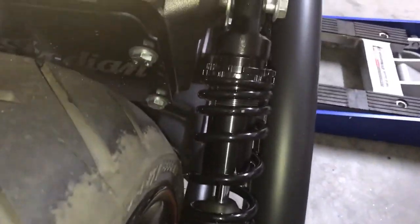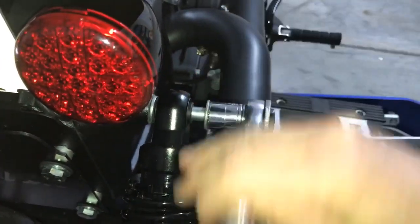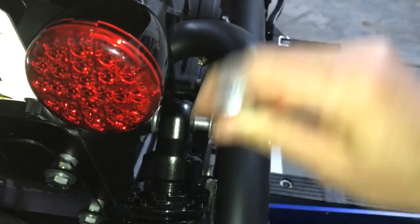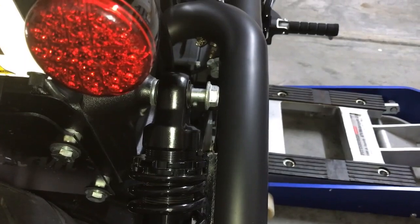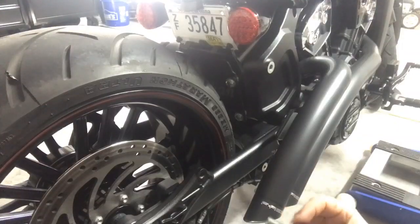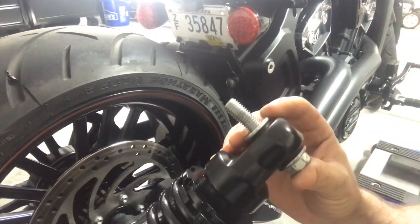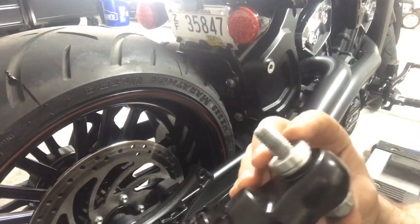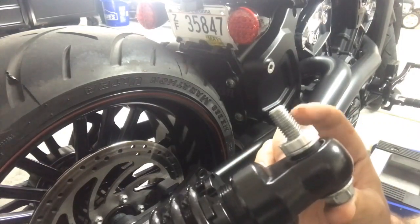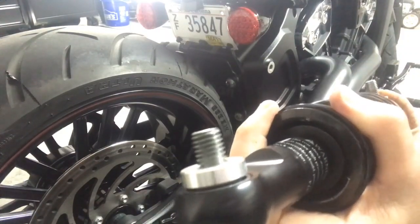You'll see the bike's gonna drop, so we're gonna do the same thing up here — take that off. I'm going to remove this here in just a second. Here's the top of the shock: we've got your stock small spacer that came on the bike, we're gonna put one of the thicker spacers on top of that, and on the bottom it's just the one thick spacer that was provided.